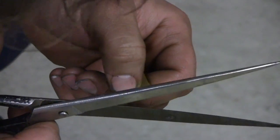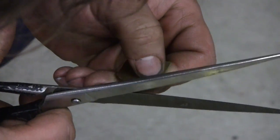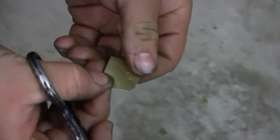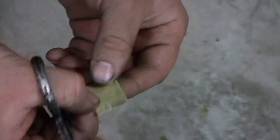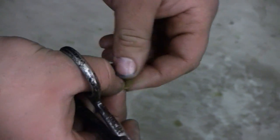But then I can file those main aluminum shims to actually take the final little bit out of it, get it fitted just right. You think it might loosen up once the engine is pounding away? It may, but I can always file it a little bit more once we get some run time into it and it breaks in.